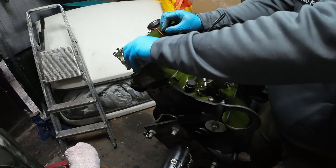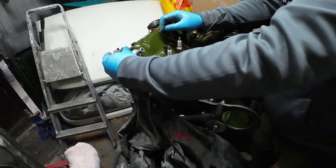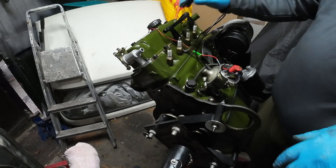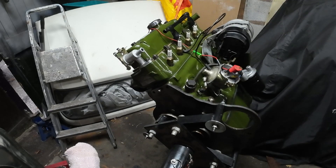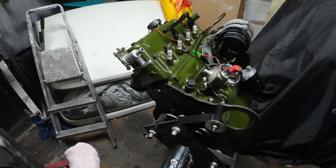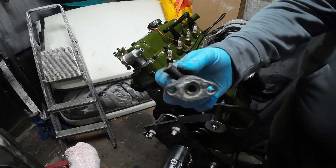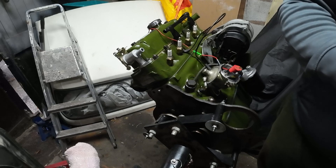Right, so that's the heater pipe — comes up, joins in with the matrix, and that's another one for the matrix. That's a lovely little heater control — your cable goes in there, pulls in there, and you can turn your heating on and off without having to get out of the car and go under the bonnet. So: tap's on, gasket's on, sump plug's on, filter's done. That old bracket is covered in cracks and in pretty rough shape, but the tap itself is okay — I'll probably try to get it out of the bracket.